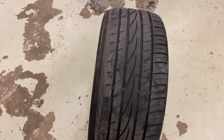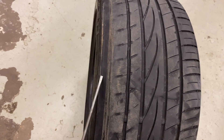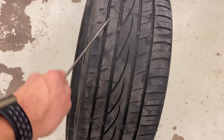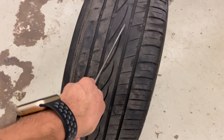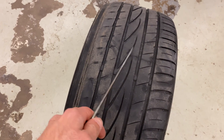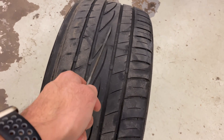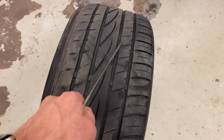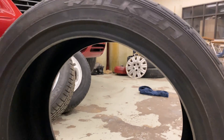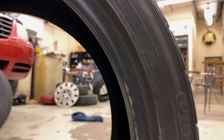Here is another example of an asymmetrical tire, though a very worn one — you can see all that inner tire wear. But again, if I split this in the middle there's a different design on this side and on that side, even though it's very hard to tell. You can see on the left side there's a little wave going up that you don't have on the other side. And on this tire I have an outside and an inside label as well — yep, right here you have the outside labeling and the inside labeling on the other side.